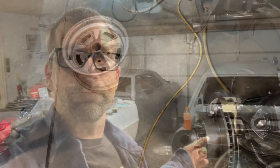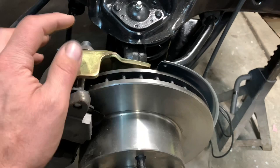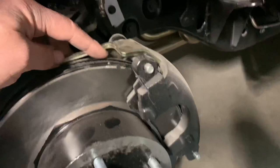This is the kit I just installed on the Great Pumpkin. This is your standard GM caliper they use on all of them — same rotor, that's all the same. This bracket looks the same, but that's where it's actually hitting and rubbing — on this bracket and all the high points. Why is it hitting on this one and not this one? We're saying: same rotor, same caliper — but this bracket is actually shaped different. I'm going to try to sight this on the horizontal.